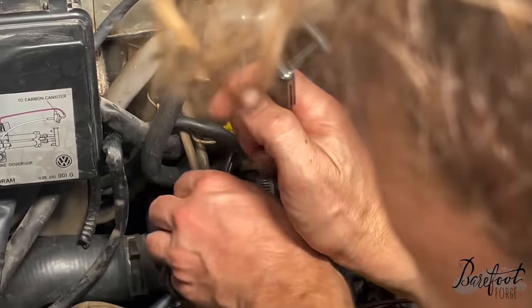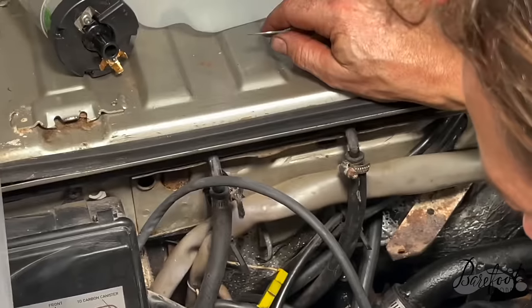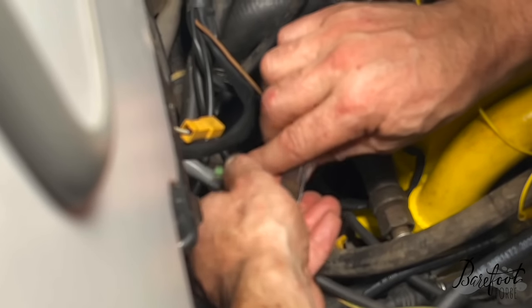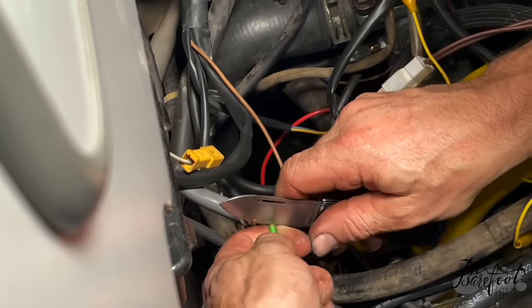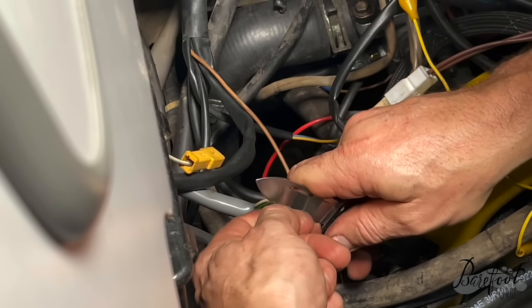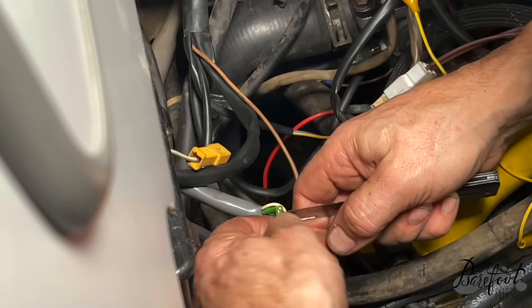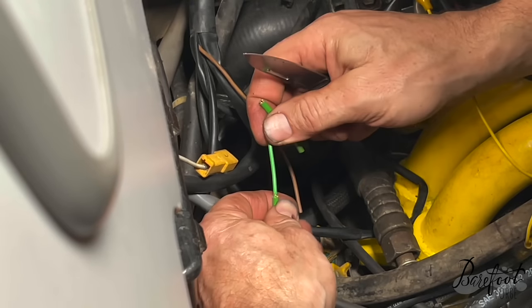But anyway, I want to... Do you have little jumper wires? Like this? Yeah, you can use that one. You're making a cut with a knife first so you can get the insulation off the outside without cutting through. Yeah, get the insulation plus the shielding wire. That's the bigger issue. Oh, you want to cut the shielding wire? I do. Okay. And then further up, we will strip the inner insulation. There. That's what I wanted to do. Oh, I've never done that.